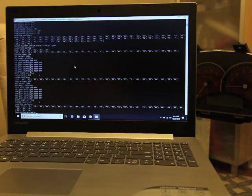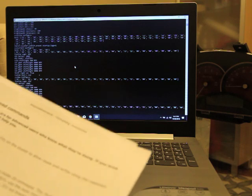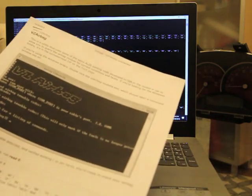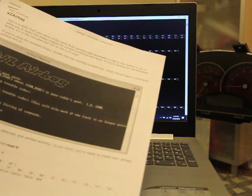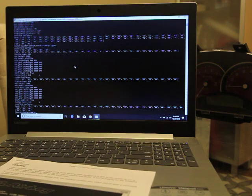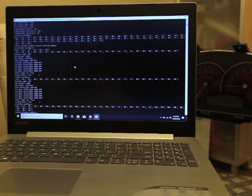That covers the basics of the presets. You can also use 'listports' to see where your cable is connected, and 'listen' to monitor BCM chatter. There's also advanced functionality I haven't explored yet. The VZ Cluster Mod also has a VZ airbag module — 'read 0' lists all airbag info, 'read codes' gives you fault codes, and 'clear codes' clears them as long as they're not hard codes.